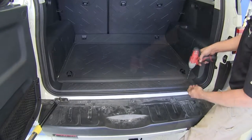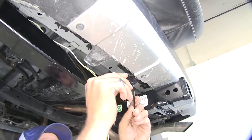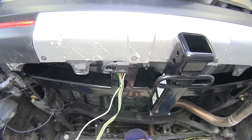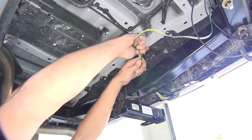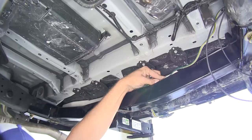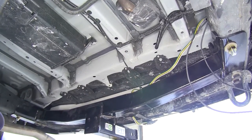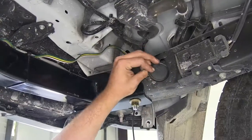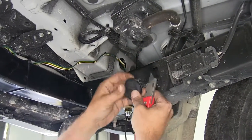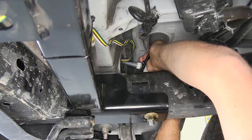Our hitch has a small bracket on it used to help hold wiring — I'm going to use that. If you don't have it, just secure it around the receiver tube or wherever works. I'm going to bundle up the excess wiring on the four pole and zip tie it right to the top of the hitch there so it'll be out of any danger and won't get hung up on anything. If anybody needs to, they can undo just a single zip tie and get some extra line to run out to their trailer. Now let's do the same thing to our lower grommet that we did to the upper one. This one's rubberized so it's a little tougher to cut, but bring it up around our wires and pop it back into place. Use a little more silicone sealant and get it sealed up.